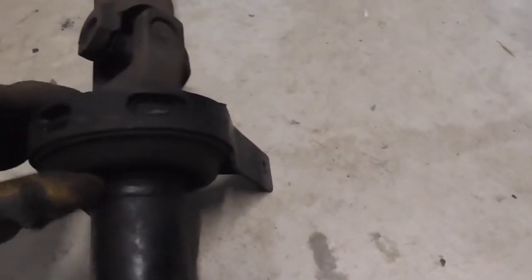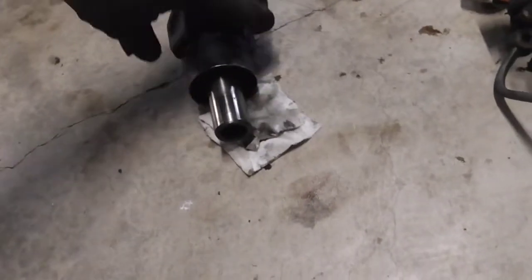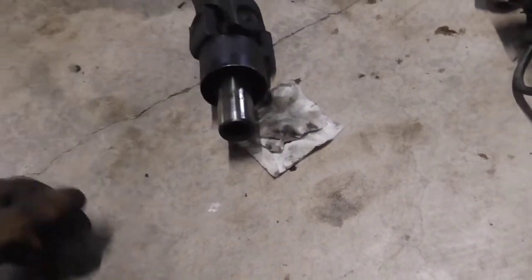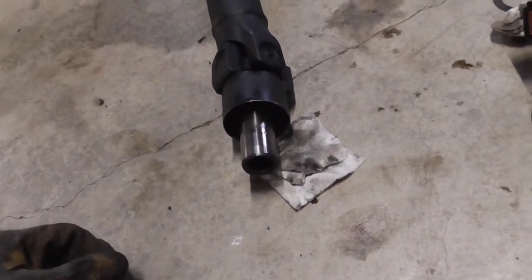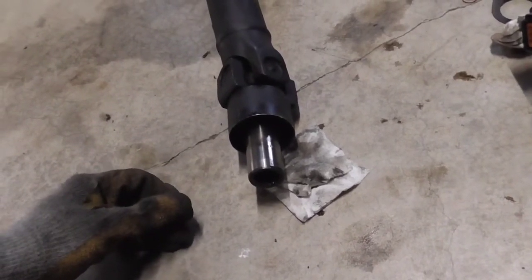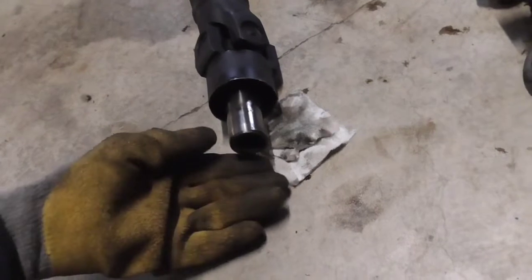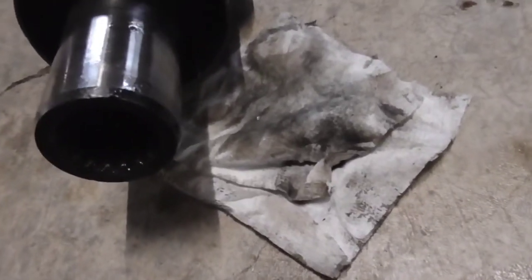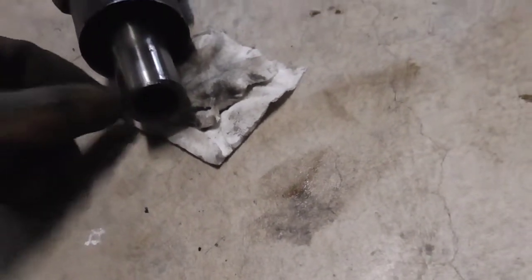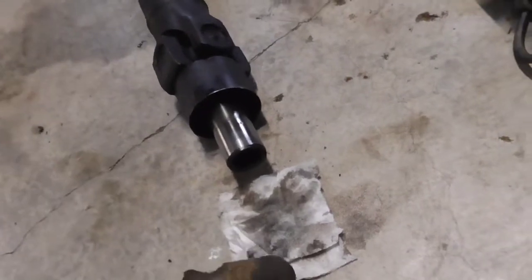So we can inspect the bushing right here and see if this is in good shape. It appears to be. Everything else seems to be pretty tight, so we should be able to reuse this. Now, at this stage, since I'm kind of doing this as I go here, I haven't decided if we're gonna put the motor into the transmission, have a special custom fabricated mounting plate, and keep the manual transmission and just bolt the motor to the transmission, or do we want to take our electric motor and stick it straight into our drive shaft? So, see, this has a splined opening there, and whether or not that's a standard size or not, we're going to have to determine that shortly. But if we can, it would be super sweet to just stick our motor right into there.